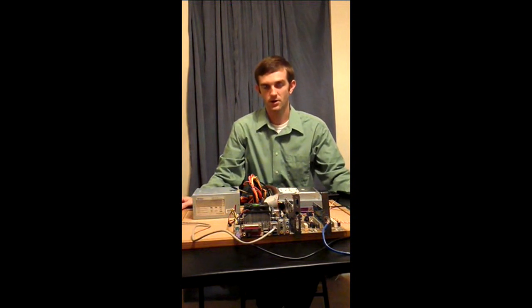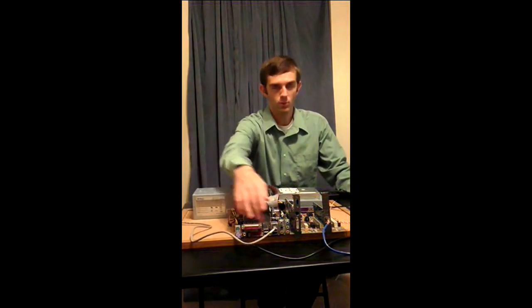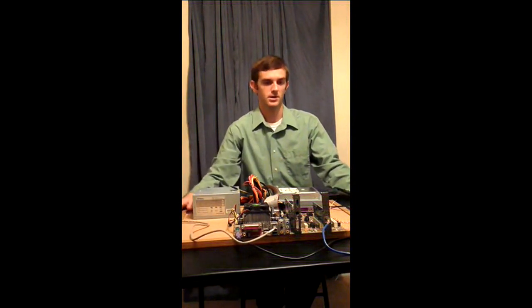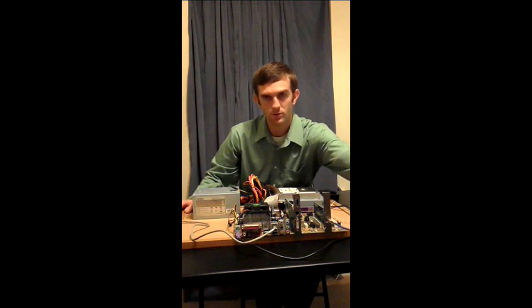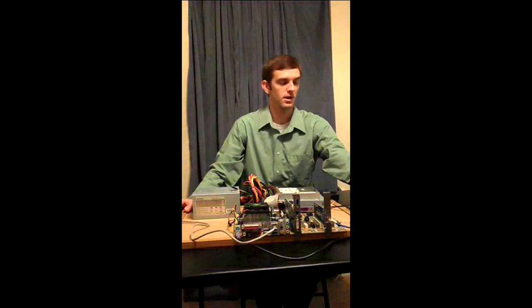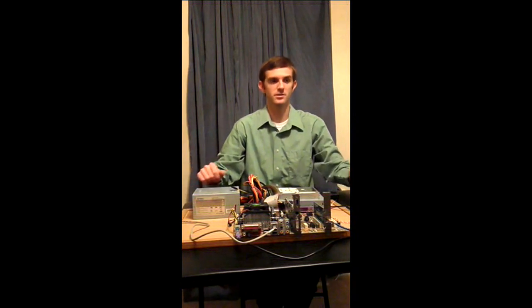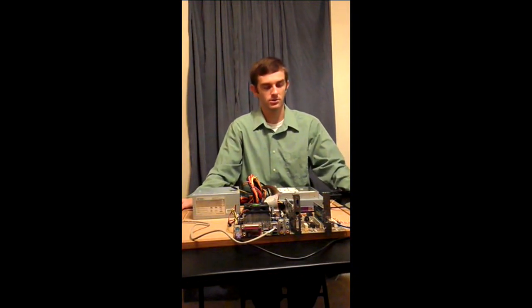Once your second Ethernet card is installed, you need an Ethernet cable leading from your onboard port to your modem. Using your second card, you plug an Ethernet cable into your workstation, or if you have multiple workstations, you plug it into a switch, and then plug each of those workstations into the switch.